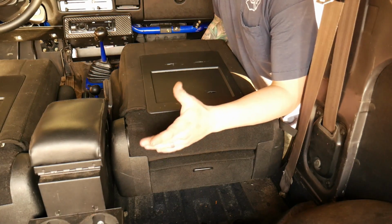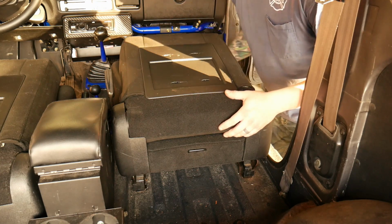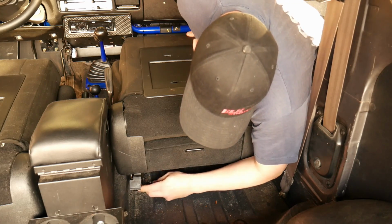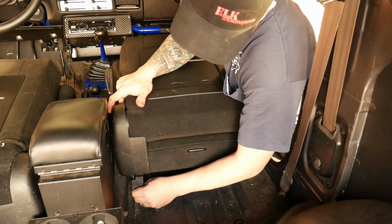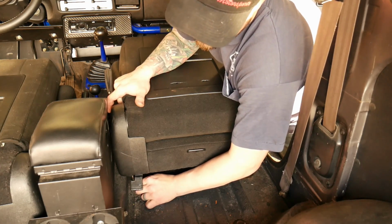Doing the exact same thing that you did on the driver's seat, you'll slide the aftermarket seat slider all the way forward. Right behind here, you'll notice you can lift this tab. That's what you'll have to do to get the access to this bolt in this hole. And you'll have to use a box-end wrench to drive these.